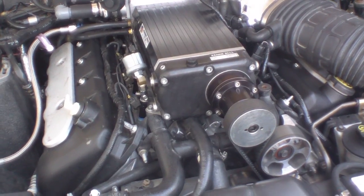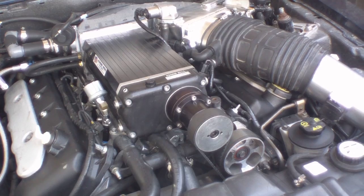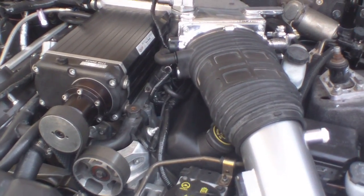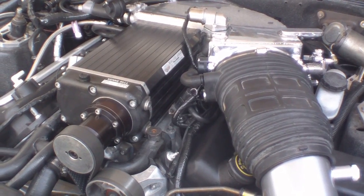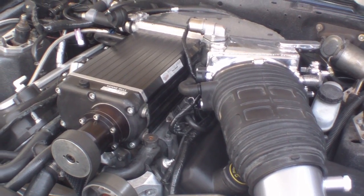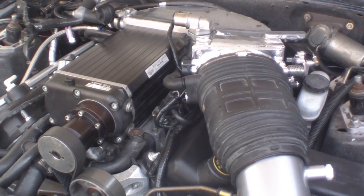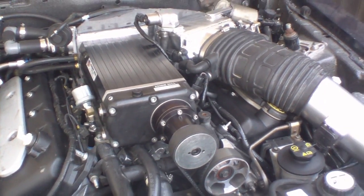Back in June of 2010, I decided to look at my manual transmission throwout bearing. I had a Viper T56. When we took it out, we found that my clutch was worn out, just from putting about 607 rear wheel horsepower through it. Decided instead of going with the twin disc, I wanted to upgrade to an automatic. And at the same time, I ended up taking on a couple other project ideas that I wanted to work on, since I was going to have to get the car retuned anyways.